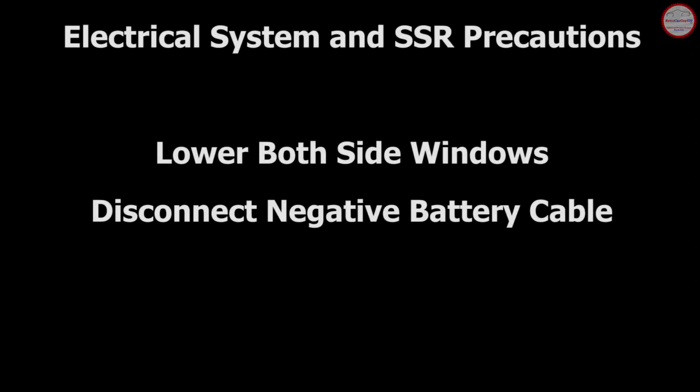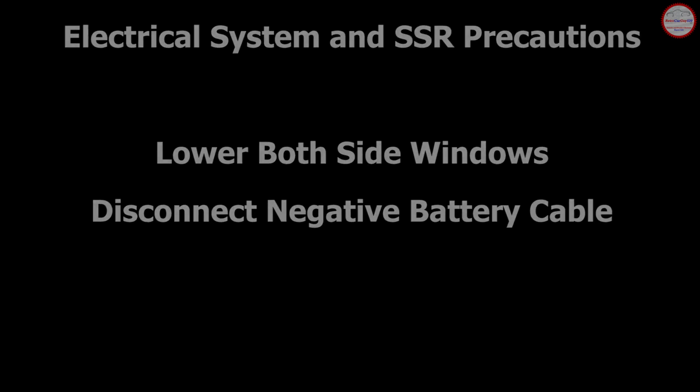There are a couple electrical system and SSR precautions I would advise you of. Before you work on any electrical component, I would suggest disconnecting the negative battery cable. But in the case of the SSR, I would also suggest prior to doing that, you also lower both side windows, since disconnecting the negative battery cable will prevent the indexing of the windows when you open and close the door, so you don't want to force the window through the door seals on both sides. So lower the windows before you disconnect the battery cable and you're ready to start.